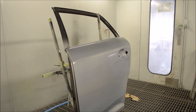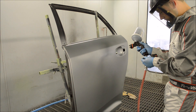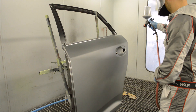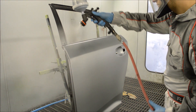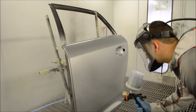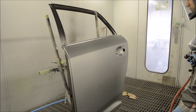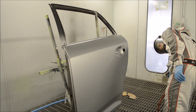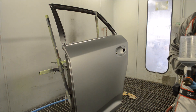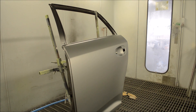Some water-based paint systems contain transparent colours such as blue, red, and yellow. This can cause trouble when applying metallics, as these transparent colours rise to the top of the base coat when over-applied — sometimes visible on the edges of panels. A gun such as the HTE setup helps eliminate this problem. Applying the drop coat here at 1.5 bar, quite far away with a tight overlap, and as you can see it's laid the metallic super smooth and ready for clear coat. Generally, the HVLP setup is quicker and wetter, while the HTE is slower and drier — so it depends on the painter's application preference to determine which setup you need.